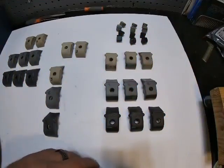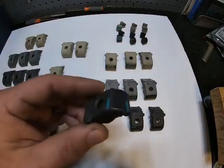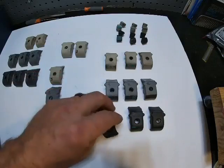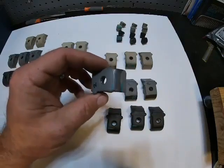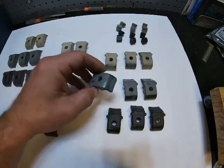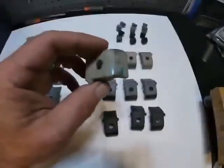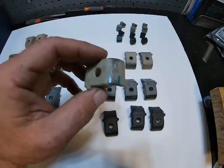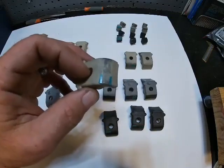On a 300-mile test of these weight blocks, the OEM block had 17 millimeters of wear. The next upgraded block had 11 millimeters of wear. And the top performance block only had 7 millimeters of wear in 300 miles — so these blocks are lasting way longer.